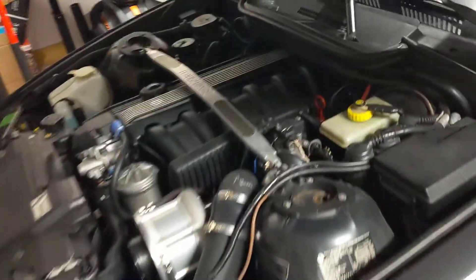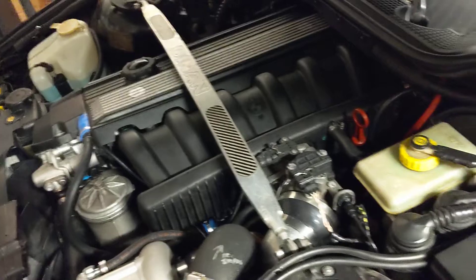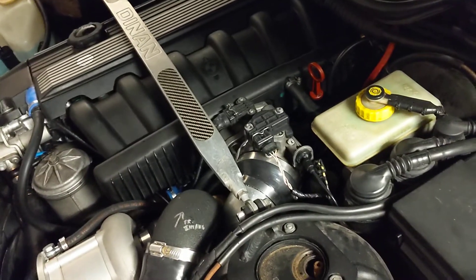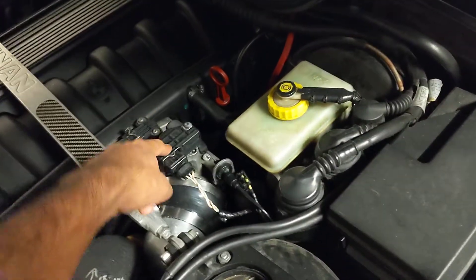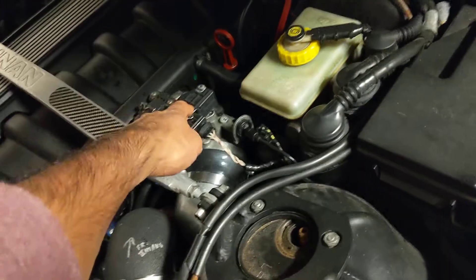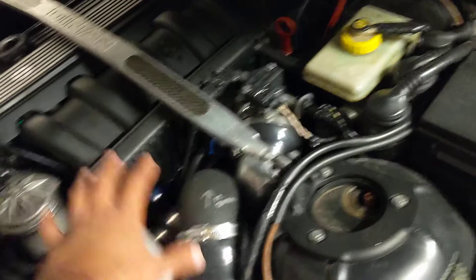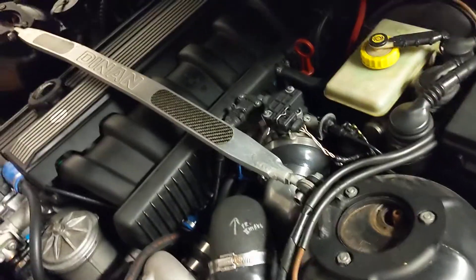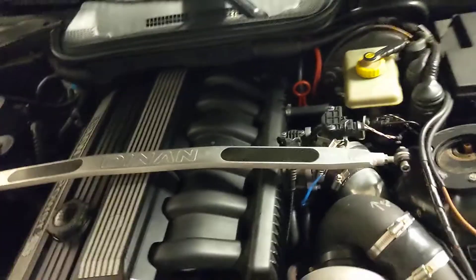The only other issue I had was the traction control cable broke. I just got rid of it entirely. If you're building this car and using these videos for research, I would just try to get rid of the ASC if you have it, because the throttle body just seems to get in the way of everything. This whole area becomes a huge pain to work on just because of that throttle body, so I'd recommend getting rid of it altogether.